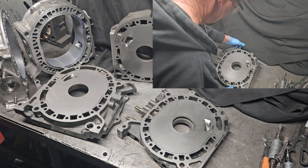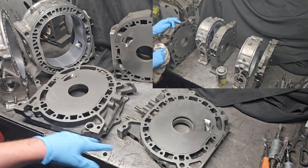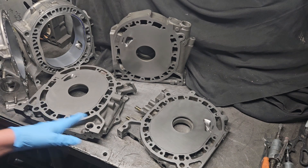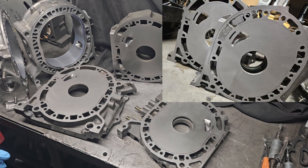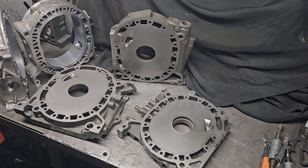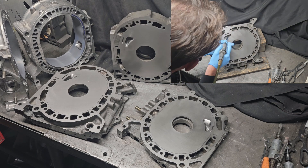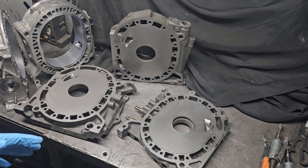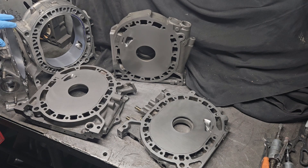So, this is a pretty cool project that came through. It's actually an early side plate — a 12A based side plate, 13B — where we've taken 12A side plates, early, I believe 1979 through 85, some variations there. I think these are actually 83 to 85. They're pretty strong plates, classic plates. They could be used in 12As, 13Bs, truck motors, the Repus, the early RXs — very versatile. They're becoming more and more rare, so this project came in for both porting and resurfacing, the lapping of the surfaces. We also matched it up to some brand new GSLSE housings.